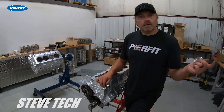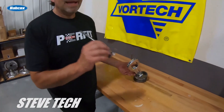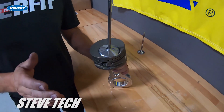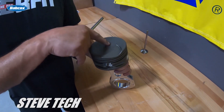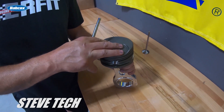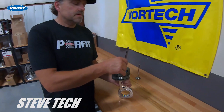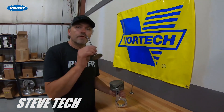Going back to show you on the piston — I know for a fact that in every engine we do, between 45 and 50 thousandths is always a good general number. The piston being at 50% in the hole really doesn't matter; that number is just giving you an anecdote of what's going on. Valve-to-piston clearance doesn't matter where the piston is — it's always going to be good in that 45 to 50 range on the intake side.